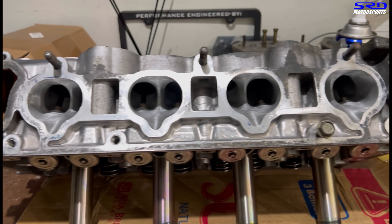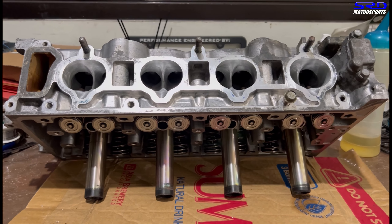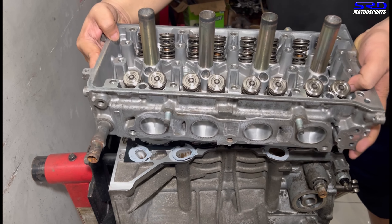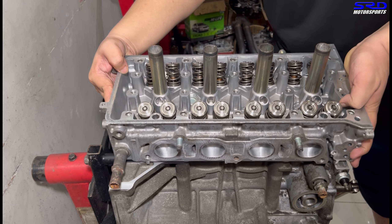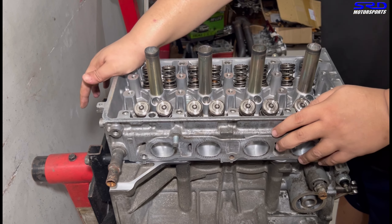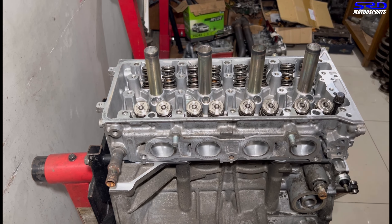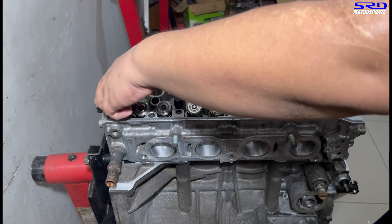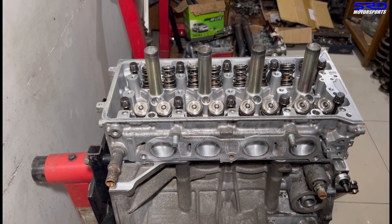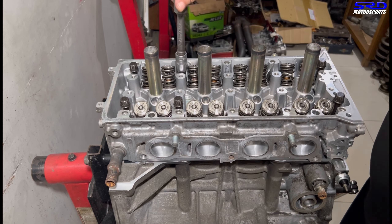Look at the underside — here's the Supertech, it's all good. We drop the head in onto the block. You got to carry this carefully so that you can drop it in on the head. Now we're dropping it in carefully. Make sure everything is aligned well, including the dowel, so it gets dropped in good. The dowel helps us align it. Now we get the head studs. We carefully drop them in — we don't literally drop them from a height because it might ruin the initial thread. Then we get the socket extension and hand-tighten all of them snug, ready for the first step of the torquing sequence.